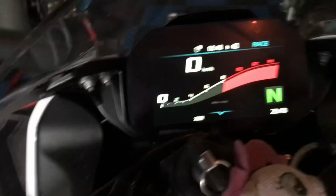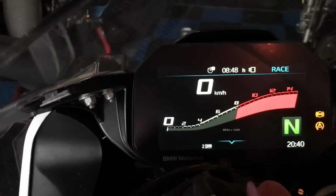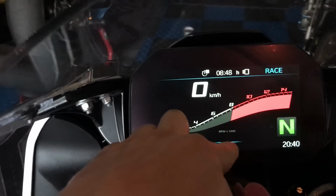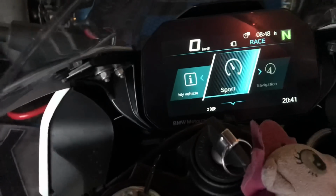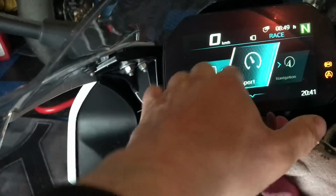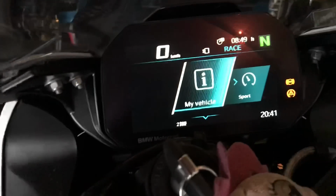If you look in this menu and we try to turn the wheel up and down, right, left, nothing will happen. I know this because the symbols are lacking on the screen. If you see at the bottom of the screen, you have an arrow down. That means that the lower base of this button is possible to use. So when I press that, I go out of the core screen and I can select left to right on this screen, because there is an arrow left to right, or an angle icon. That means that the wheel is operational. Left, right, and we can go through all the menu functions for people to see.